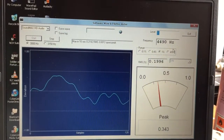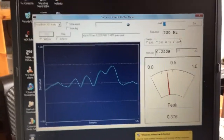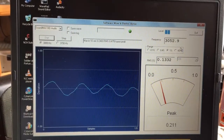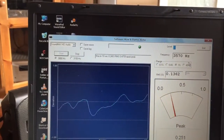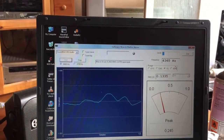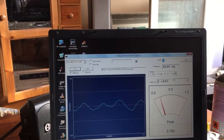I was about to say on the whole deck B is alright, but that's a bit bizarre. So — I'm going to say that is the pinch rollers. The way that comes round, shoots up and then goes back to normal — I'm going to say the pinch rollers are out of shape. Let's look into that.